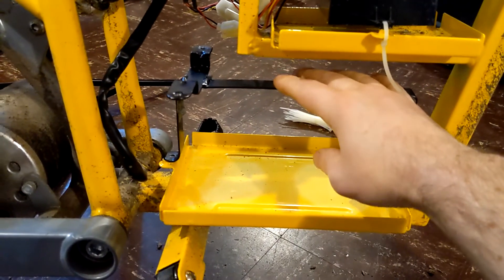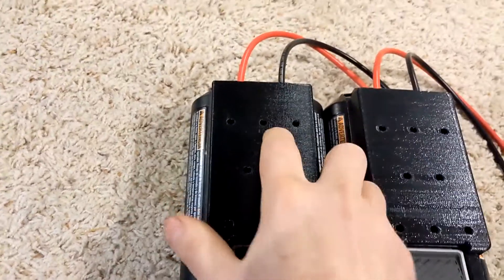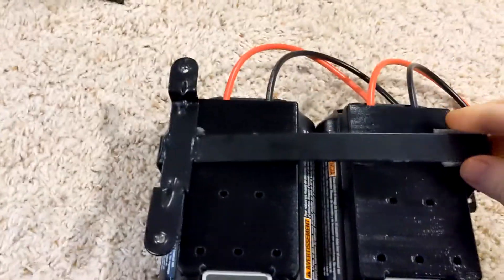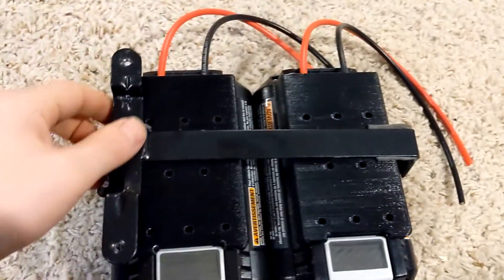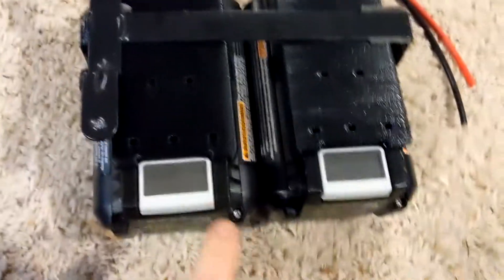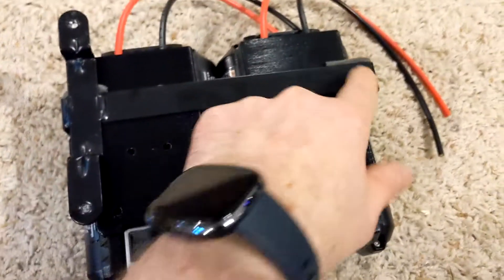I've switched sides of the bike now. This is the bracket that goes right here — it used to hold the bottom batteries in, and this is what we're going to mount our new battery holders to. Here are my batteries with the new mounts already on. I'm going to put some two-sided tape on the back of this, put it right where I want it over the back mounting holes, so that the batteries are offset to one side. I'll get it stuck, then take the batteries out, drill some holes, and put some screws through here so it'll all stay together.